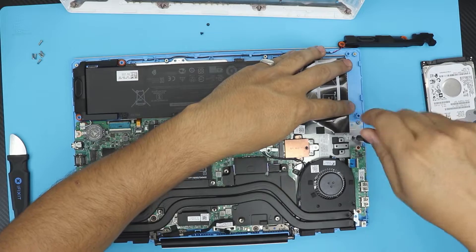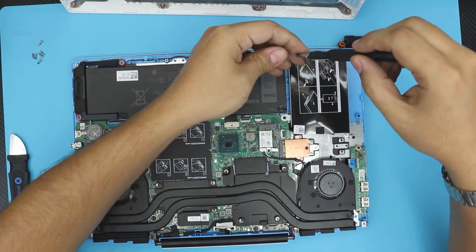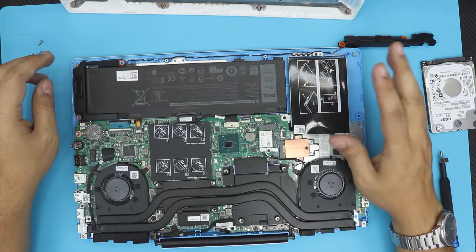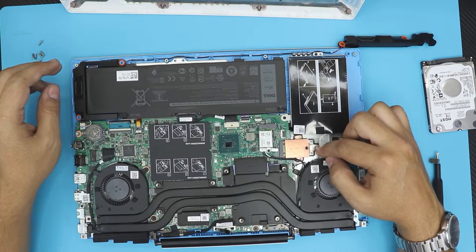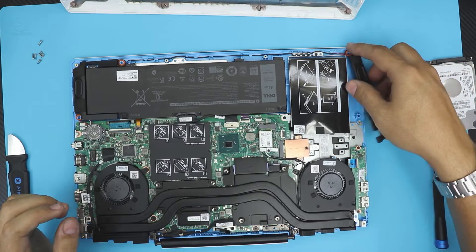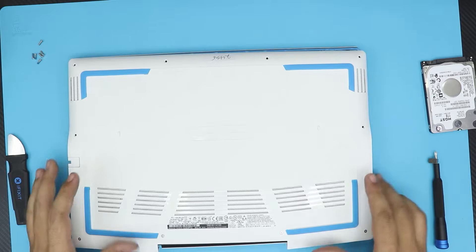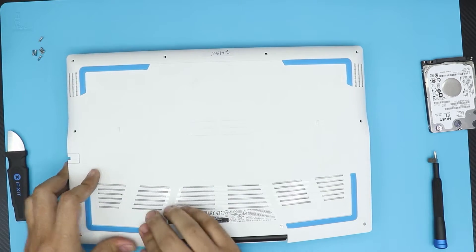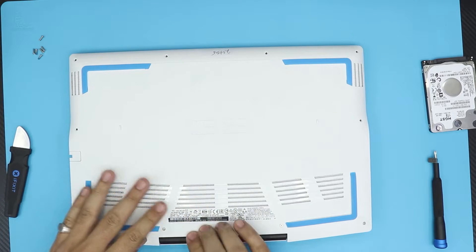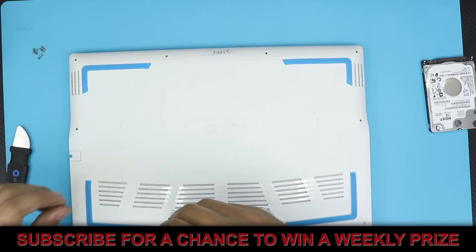That's how you add the extra hard drive. You can add a mechanical hard drive or an extra SSD drive — it supports both. You can put up to a four terabyte hard drive in there. You can also remove your NVMe SSD by removing one screw and it just comes out like a memory module, and you can add a bigger one. Then put the speakers back in, grab the bottom cover heatsink-side down, push it down in the corners and sides until you hear those clicks, then tie down the screws and you're set to go.